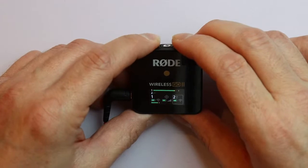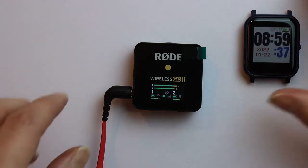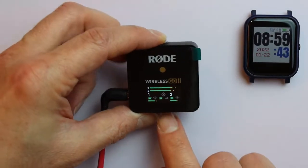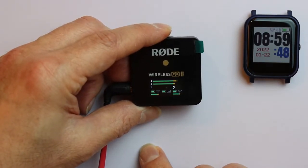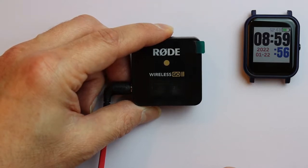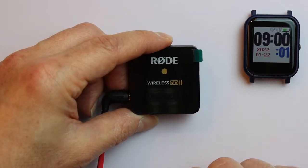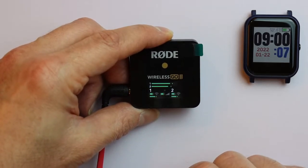For the third option I need to watch the display: there is the on/off switch and the brightness control. If you press the on/off switch once briefly, the brightness control changes, and now after 10 seconds of inactivity the display will turn off. This is sensible in dark environments, but it also prevents accidental setting changes because now the buttons are more or less locked — pressing any button only turns the display back on and nothing else changes.